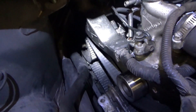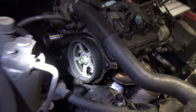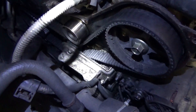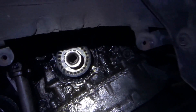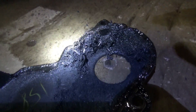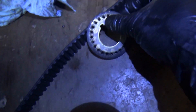The entire front of the engine is covered in oil goop residue. Potentially the cam seals are leaking a little bit — or the valve cover gaskets, or everything. We'll keep tearing it down to see what we find. I do believe the big oil leak is coming from the cam seals because both sides of the engine are very messy. There's shredded belt material all over this thing, and it mixes with the oil to create a nice soft paste. It basically filled the entire bottom cover of the timing belt. I think I found the mystery of the belt shred material.